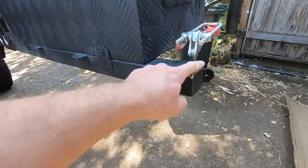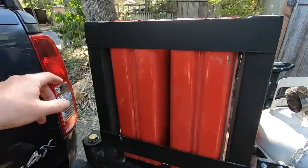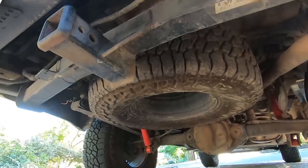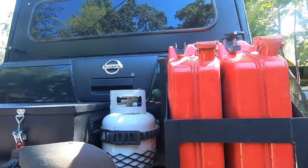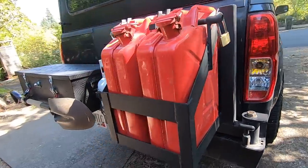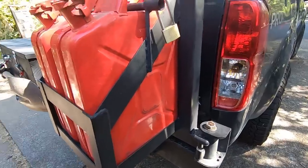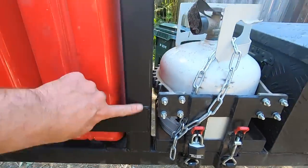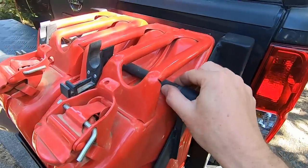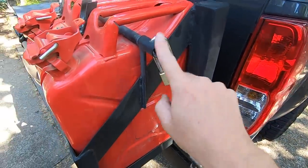The arm itself is made of two-inch by two-inch eighth-inch thick steel tube, as are the risers for the jerry can holder, which are really just incorporated as part of the swing arm. Because my spare tire fits in the factory location underneath the truck bed, the primary need for the bumper was to carry extra fuel. These posts are more of the same two-by-two tubing, and the bottom structure is eighth-inch thick two-inch by two-inch angle. This bar here passes through the handles and both keeps the jerry cans from coming out and secures them.